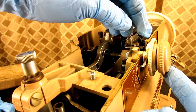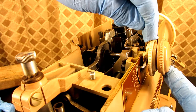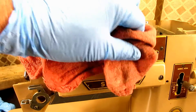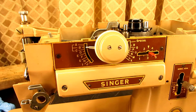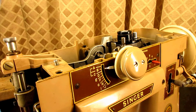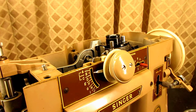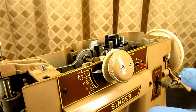I went in here to show you from the side — yours probably isn't loose — but there's a little gap back here between the two knobs and you can kind of spray down in there with penetrating oil. It'll drip all over, so that's why I hung the glove on there. I did that two or three times in the evening. I'm going to see if they're loose enough now. I didn't see any rust on them — they were dirty but no rust. If you have rust, treat them with rust remover first before applying penetrating oil, because rust remover won't work if you've already oiled or greased something.